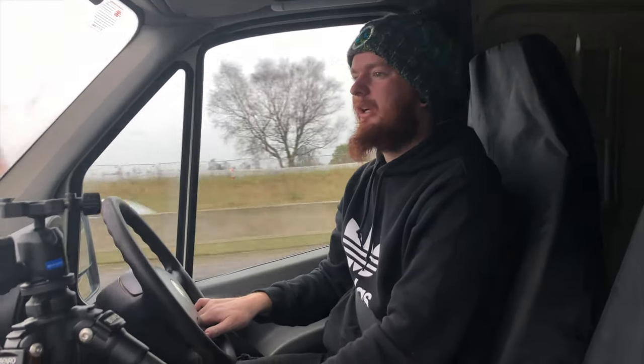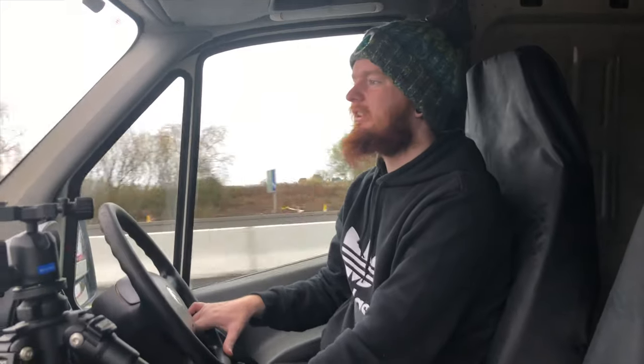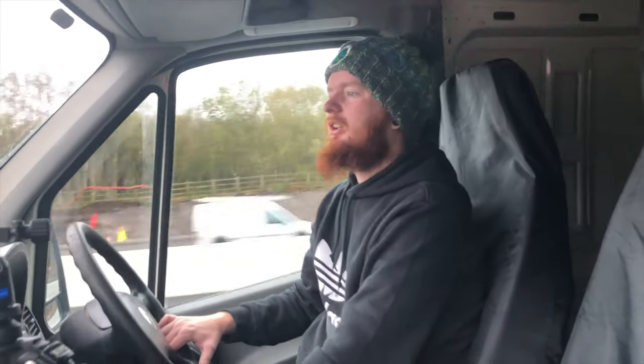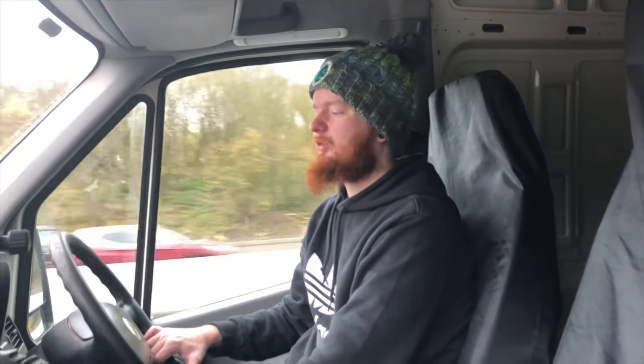It's going to be fully off-grid. We're going to have 70 litres of water on board, probably an 85-litre LPG gas tank which is refillable — that makes things a lot easier as we're planning to travel to Europe eventually. We're planning on having at least 400 amp hours of leisure battery on board, about 660 watts of solar on the roof. Going conservatively, we're only going for a 1200-watt inverter as that's enough to run a small low-wattage microwave, a toaster, a laptop, and smaller things. We don't need a big 3000-watt pure sine inverter — there's just no need for it and the extra expense.